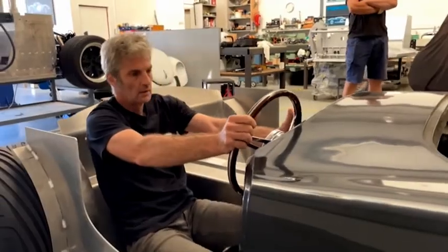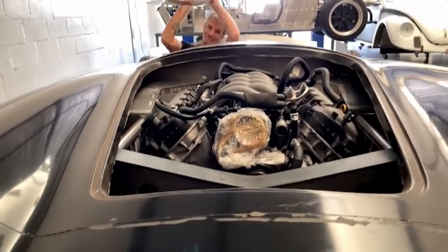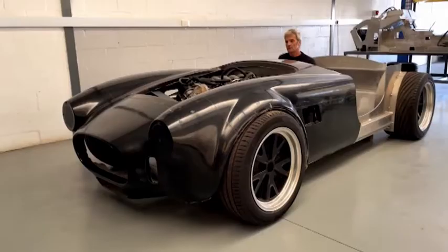I think, though, it's safe to say that if you take a well-engineered vehicle that's got all the options to adjust camber, caster, toe-in, toe-out, spring rates, damping, all these bits, and you put it onto a chassis that is stiff enough, there is no reason why you can't get it to do exactly what you want it to do. If you can play with front anti-roll bar, if you can play with rear anti-roll bar, you can make this car do exceptional things.